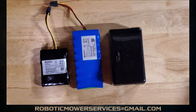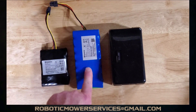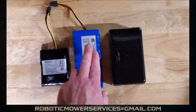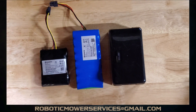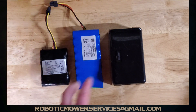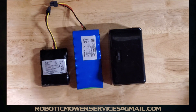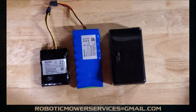The real gray area is with the 450X and the 430X, because it was a running change. In 2019 you started seeing the encapsulated packs pop up, and by 2020 they had fully transitioned. So if you have a 2018, 2017, or 2016 450X or 430X, you've definitely got the blue packs. If you have a 2020 model, you've got the encapsulated ones.